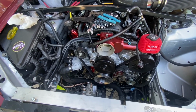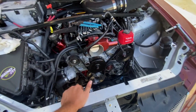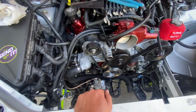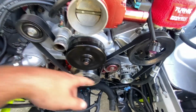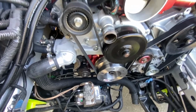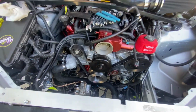So that won't happen before the cage, I don't think, because I'd have to keep it like this. I don't know, maybe. I'll go order one tonight, see if it ships out and gets here in time. Slapping a water pump isn't a big deal either. I'll just hold off from putting the rad back in, and from there it's just these 3 water lines, pop the hose off and pop the belt off, and then pop this tensioner off to get access to the bolts back here. And then it's 3 bolts there, 3 bolts there. I have another set of gaskets. I mean, these gaskets are brand new anyways. And then you swap your tensioner over. So I guess I'll get another water pump on order. Fun stuff. Love to see it.